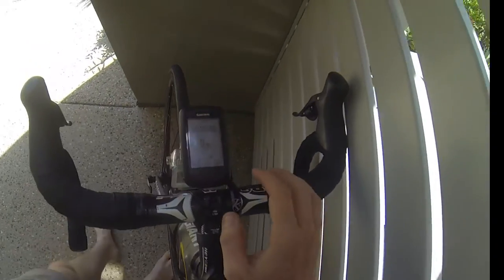Power meter is detected. On your Garmin go to menu, settings, bike settings, bike profiles, bike force current, power, and then just go to calibrate. It should be between 850 and 950 — mine's 934, it's always 934 or 933, so that's calibrated correctly and I'm ready to ride.